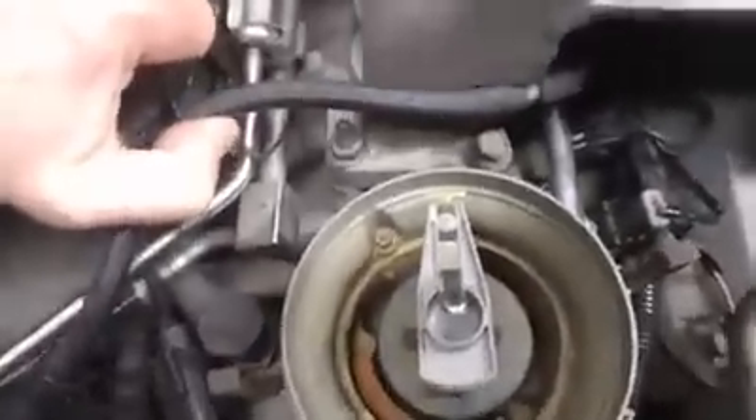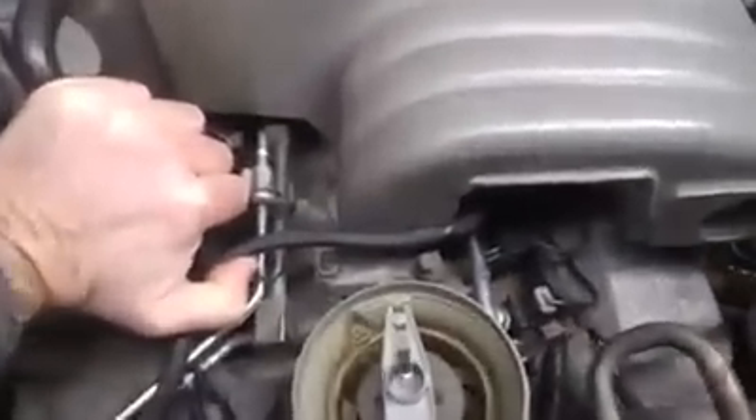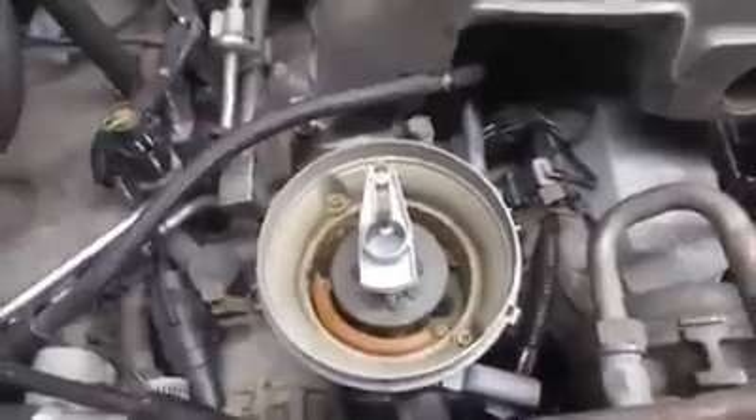Here's the visual reference: you've got the two lower intake bolts in the front — you see them right there. If you've got this thing pointed right, the rotor button points just to the left of the right intake bolt. So there's your right intake bolt; the rotor is about a half inch to the left in its alignment of that. That's about the perfect spot, but that's the easy part.